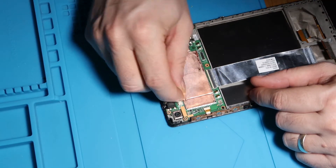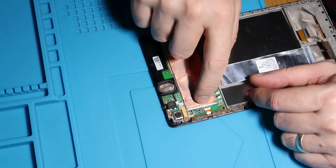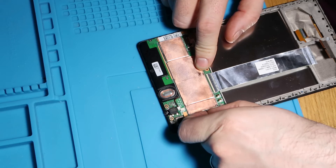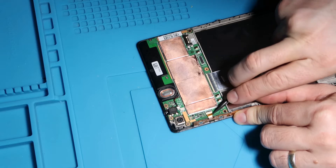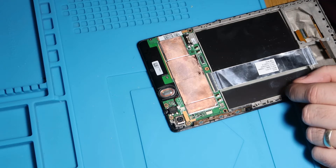And then at the top here, we've got a second speaker and quite a bit more. So first things first, we'll disconnect our speaker just like that. Then we'll disconnect the ribbon cable to this side by pulling this little clippy bit up and pulling this cable out. It should just come out. Just use a spudger. Just gently ease it out. There we go.